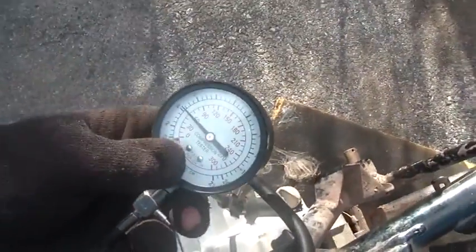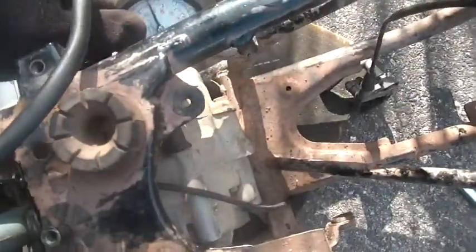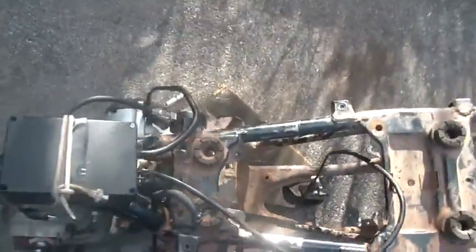To be honest, the compression is coming in exactly where it was before — somewhere around 75 PSI exactly. So that means I either have a valve that's a little tight or a valve that's leaking by.